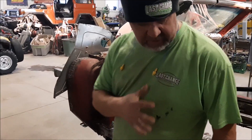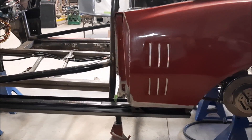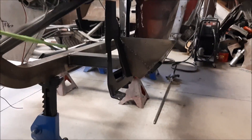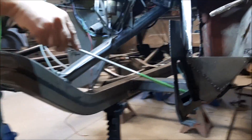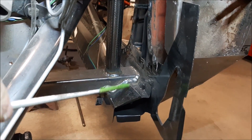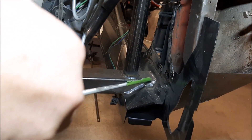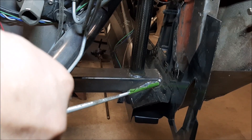The focus has been on rebuilding or reconstructing this driver's side. Hopefully the lighting is decent — I have a flashlight here. Essentially this is our driver front area. We've moved some of the panels out of the way, and you can see where we have this new factory rocker panel, inner and outer. You can see where we have this heavy plate that we made — they had a lot of gaps in the tubing that was here previously, and it wasn't welded solid like we have it now.